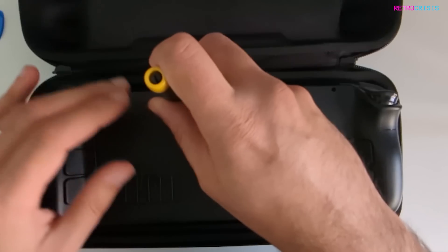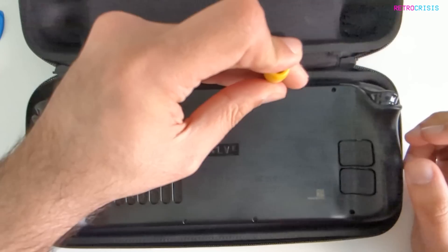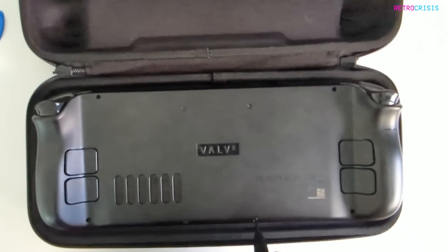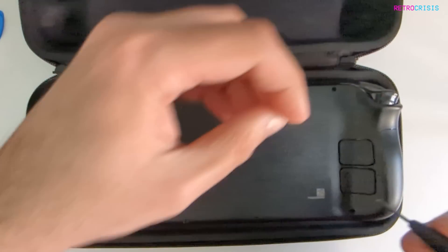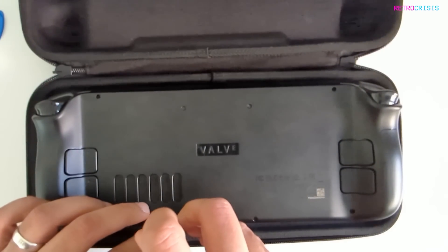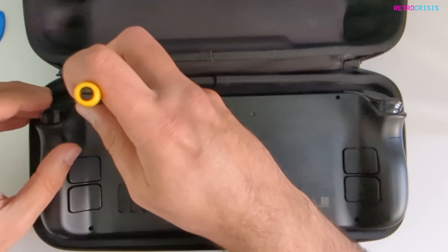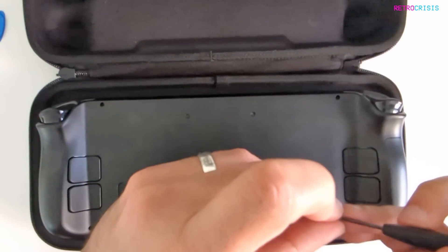And as I said before, I'm not going to mega-tighten any of the screws. I'm just going to tighten them up enough where it's secure, but loose enough where if I need to open it up again because I've ruined something, I can open it up fairly easily. Now the long chassis screws. All those videos of people taking their Steam Decks apart using electric screwdrivers makes me very nervous with these little fragile, teeny screws. Okay, we're done.